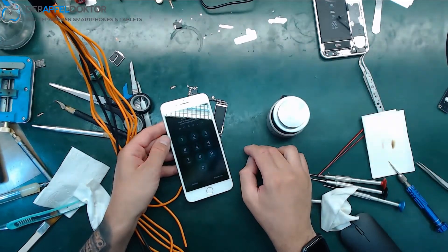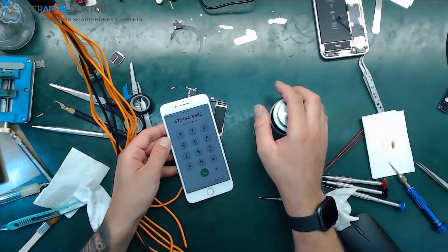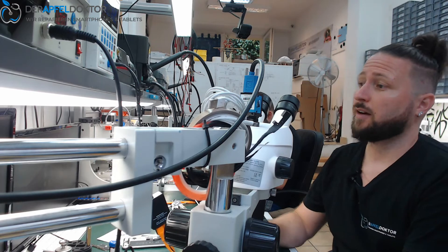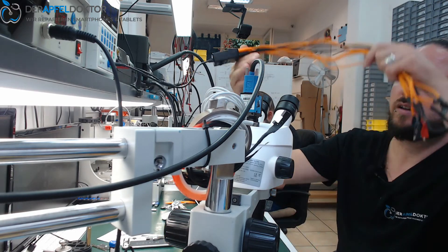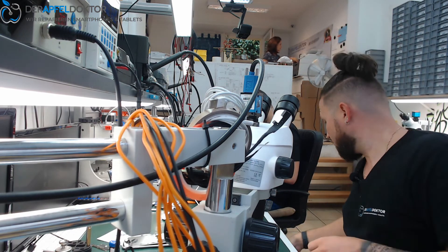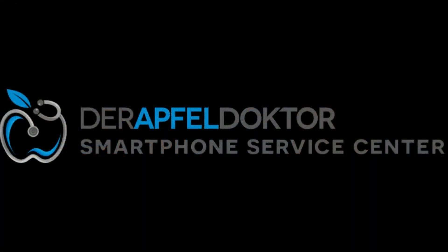Seal it with the original glue sticker and we are done. It just lags a little bit on the DC power supply so it just needs some time until it reacts. That's it — just a fast repair on an iPhone 7 Plus. Only a little short on VDD main and the whole device was without any function. Now the customer has back his important data and the phone is fully working again. If you want to learn things like that, you can do that on the portal of Repair School Germany. If you are working in the repair industry for smartphones and tablets, you can join our Facebook group Smartphone Repair Group Germany. We see us again with the next video — goodbye, yours Ben.